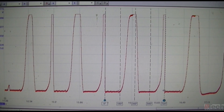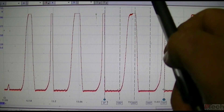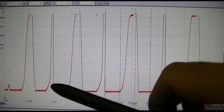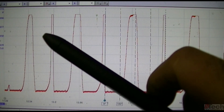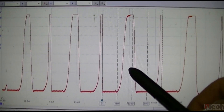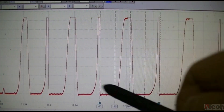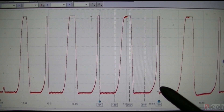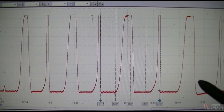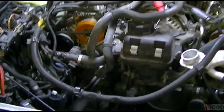The fact that we're seeing what we're seeing is because the exhaust cam timing is super advanced — so far advanced the engine cannot run, which is why this bank doesn't contribute. You have to do this on all four cylinders on that bank to make sure you see the same picture. You don't want to sell a timing job if you don't know whether all cylinders are able to seal and release pressure.